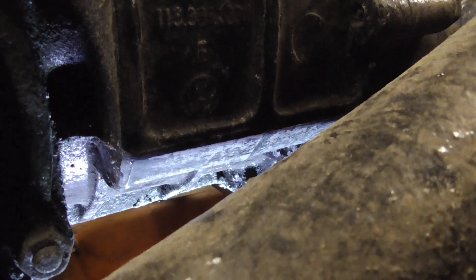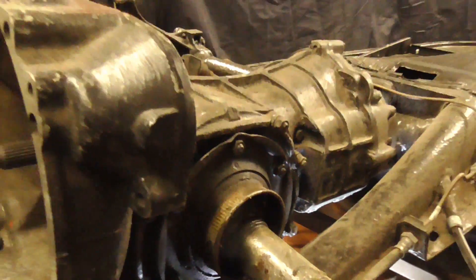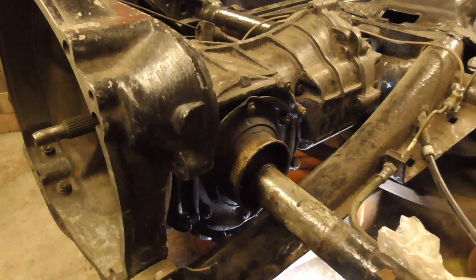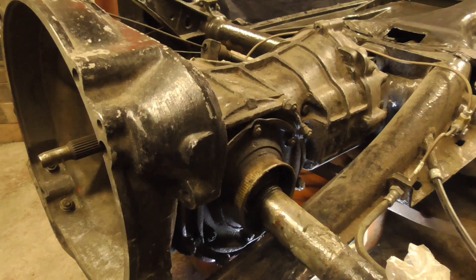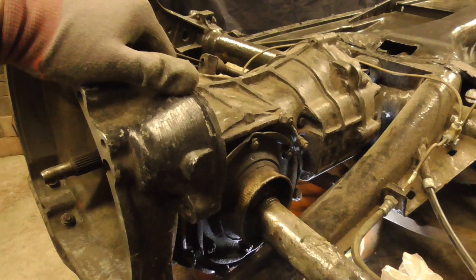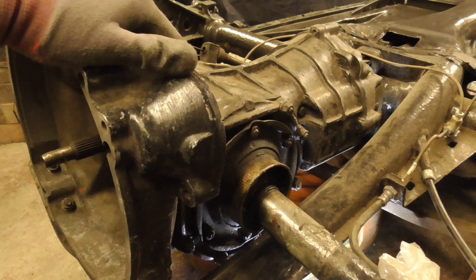If you look under there — I've had a good clean up with some emery paper and I've got the light on — you can just see an A and a C, which is the important part, and then some more numbers. The AC is what we're looking for. I'll link to all the codes and gear ratios in the description below. That tells me this gearbox is hopefully a 1500, and it could also be a 1300 because they shared the same AC code for some reason.